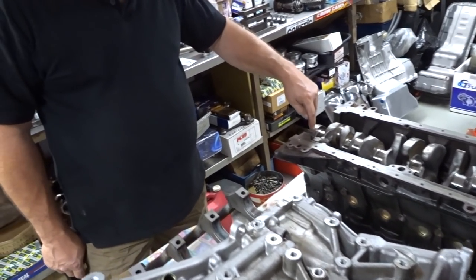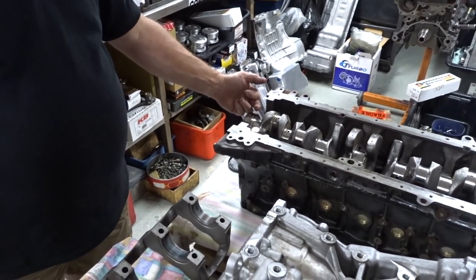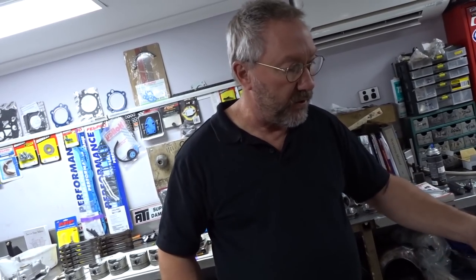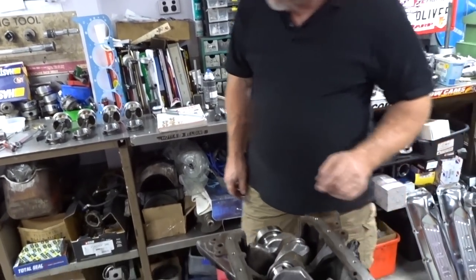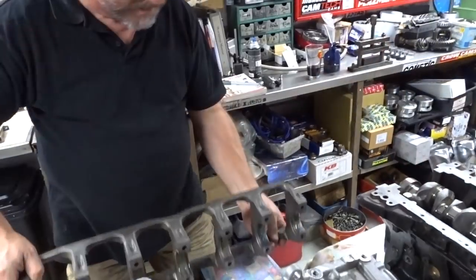There is a type of bearing called a fully grooved bearing which has got a groove all the way around, but there are weaknesses with it - you lose bearing load area because you've got a groove there and only little bits either side taking the load. That's why on the RB26 they run an annular groove behind the shell which feeds either side of the bearing from behind the shell - nice setup. Can do it on the RB30s - I've done it before. I've got a tool that I've made up that puts a channel in the back of the bearing and then drills a hole on the other side to feed it. But normally if you get that serious you sort of stick to a smaller motor - the 26s have got some nice things about them for the high-end motors, with the smaller stroke and the design of the block with the oiling. As the old guy I used to work with had a good saying - we're building a race motor out of a town carriage!